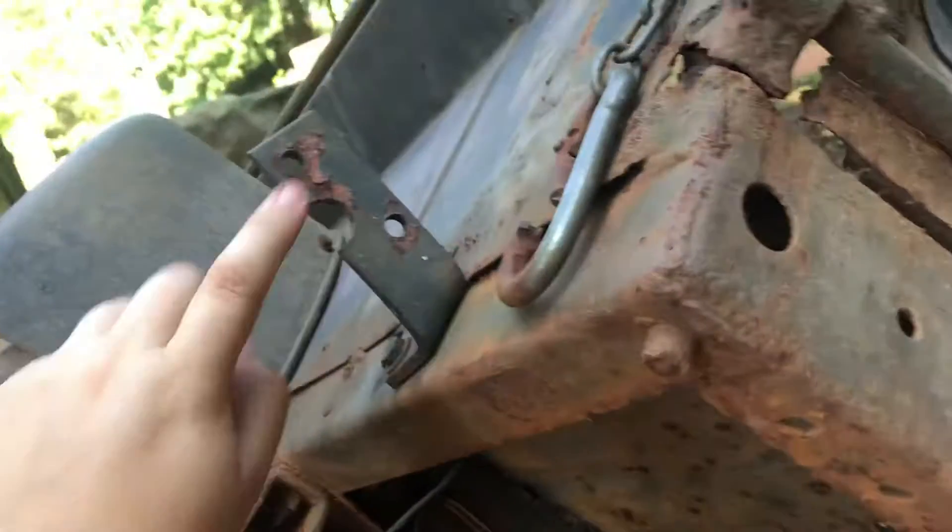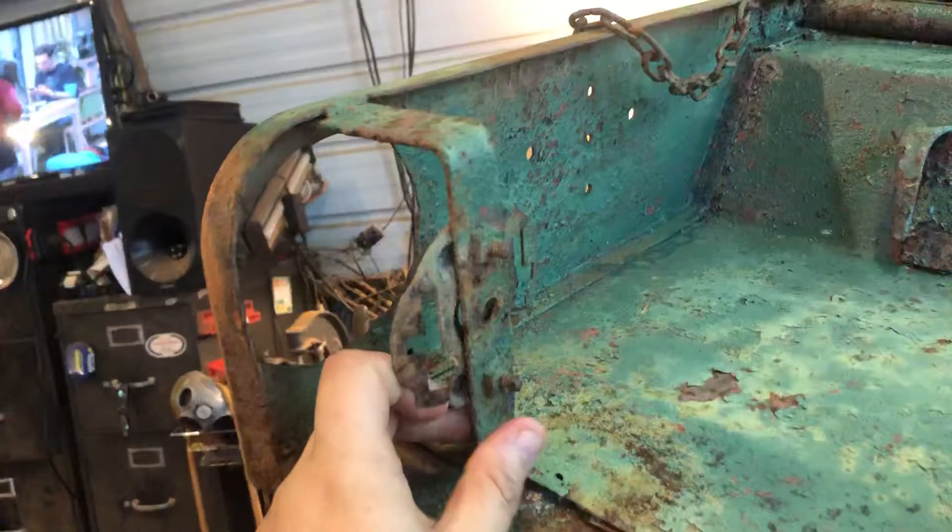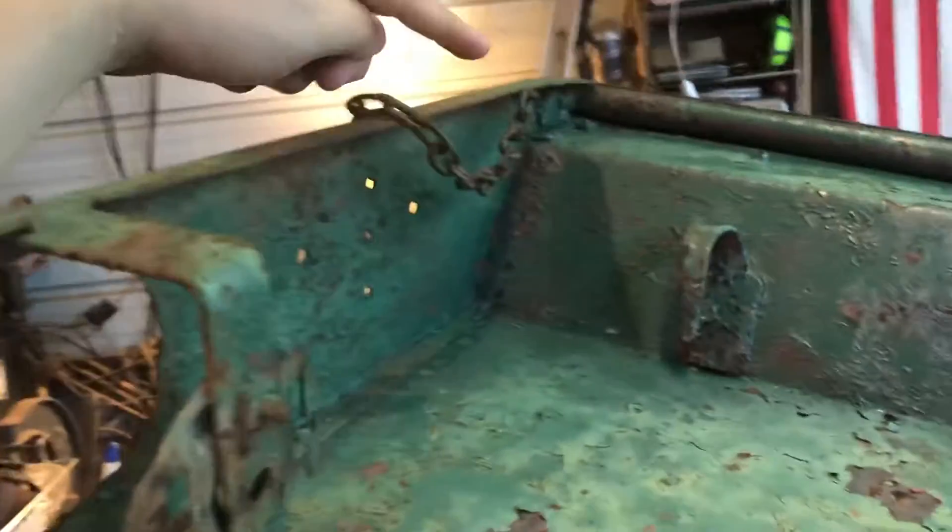This particular M100 does have a tailgate cut in it. I put them up on their sides to get a good look at the bottom. This is the taillight bracket right here, and it's got a support — a wing or ear — coming off of it. Because these trailers have no support when the tailgate is cut in, the bed will just flop around badly, so they put these on there to give it some support.